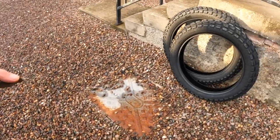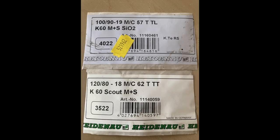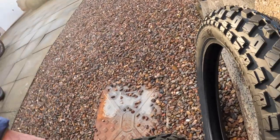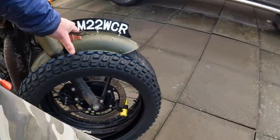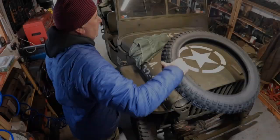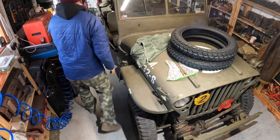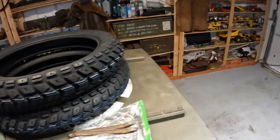The reason I was getting the tire levers out is because these new tires have arrived to fit this week while I'm on holiday. I can't quite pronounce the make — they're Dutch. It's quite confusing going from metric to imperial tire sizes. The rear is straightforward at 4 inches, but finding a 350 by 19 front tire is quite hard. I wanted a square tread classic style but these will be better for road riding — this bike isn't a heavy off-road or green lane bike.